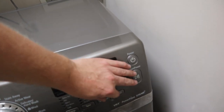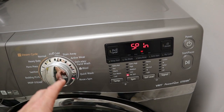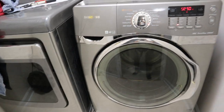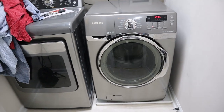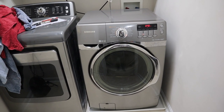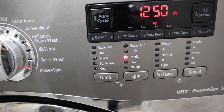Let's power on and do a little test. I'm going to throw it in test mode — hold down the soil level signal and power, then turn the jog switch to spin and start. The first thing it should do is drain all the water and start spinning — and we're spinning! I haven't balanced it yet so it's bouncing around a bit. It needs to cycle through low, medium, high, and extra high spin speeds.